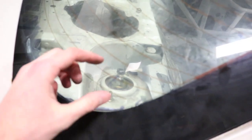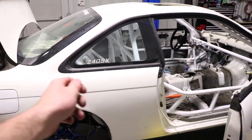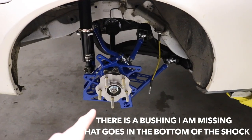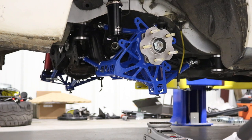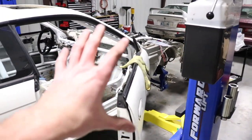Installing the new BC Racing coilovers — I went ahead and put the two top nuts in first. Help of a friend definitely helps so you can stick it up and the other person can screw on the top nuts. At the bottom, I'm going to go ahead and get my floor jack, jack up the lower knuckle where it lines up perfectly, slide my bolt through, and we should be good to go. The rear coilovers are all installed and the front is done too.